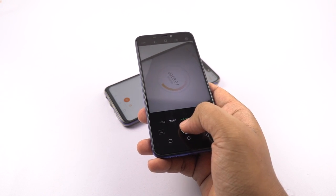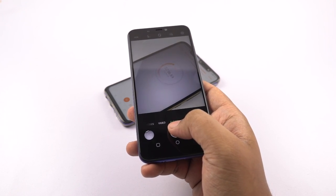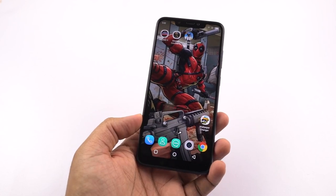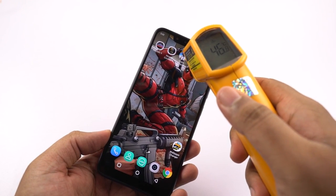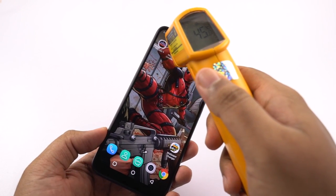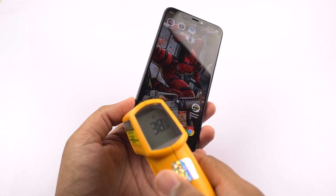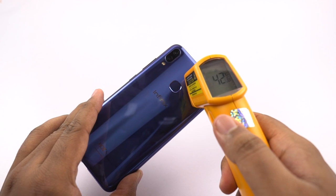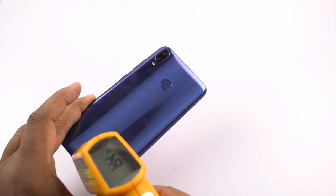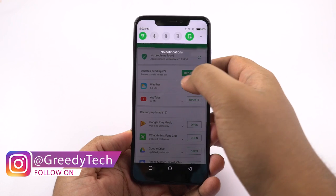The phone is lagging a bit while taking pictures, there is a slight bit of throttling, and the capturing speeds are going down because of the heating issues. It's been about 3 minutes since I've been taking pictures — I've taken 213 pictures in those 3 minutes, and that's kinda ok. I've seen phones taking less than 200 pictures in the same 3 minutes, so this phone is kinda ok. On the front, I've seen a maximum of 47 degrees; at the bottom it's 38 degrees. On the back, I've seen a maximum of 47 degrees, and at the bottom it's 36 degrees. The phone definitely feels pretty hot, especially near the rear camera and the front notch.